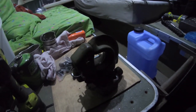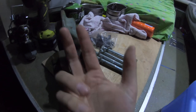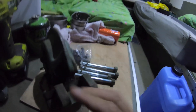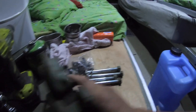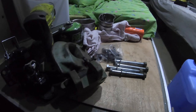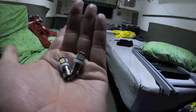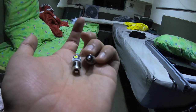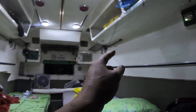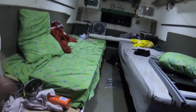It's night time now and I've been doing some homework. This hitch here - this bit is where two little forks are supposed to drop across to lock it in position. I'm going to see if I can engineer something to do that, or find one, otherwise I might just whack a hole through there anyway. That can sit on hold. I've been busy in the workshop - I've modified a couple of these little globes. These are 12 volt globes and I've put a 390 ohm resistor in the base to slow them down so I can run them on 24 volts.